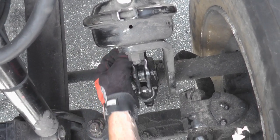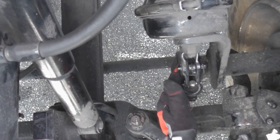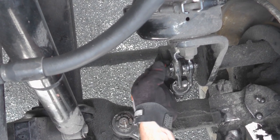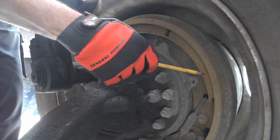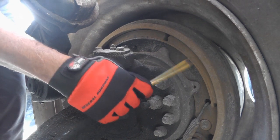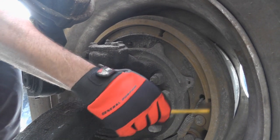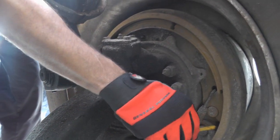I want to make sure my pushrod is not bent and is properly secured to my slack adjuster. This is an automatic slack adjuster and it should not pull more than one inch. The clevis pin secures the slack adjuster to my pushrod — we want to make sure it's not damaged or missing, and that it's secured by a safety pin. I'm talking about my brake lining — making sure it's not cracked or damaged, and the remaining wear is not less than a quarter of an inch. We're going to check our brake drum — making sure it's not cracked and there is no oil residue. Oil residue would come from our axle seal if it is leaking, which is inside our hubs.